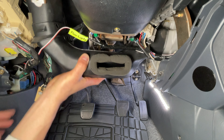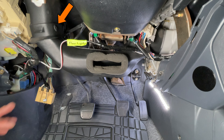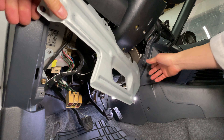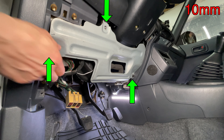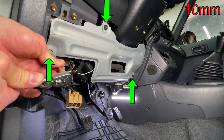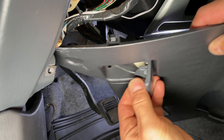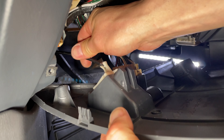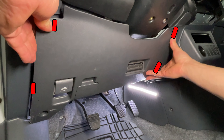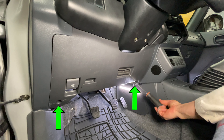Install the right side of the vent duct first, then the left. The push pin starts with the pin sticking out and is locked when you push the pin flat. This metal panel can hang from the little hook above the middle bolt. Install all three bolts with your fingers first, then go back and tighten them with a 10mm socket. Snap the fuse box back into the lower plastic trim, then reinstall the hood release cable back into the handle. The lower plastic is held on by four snaps — the upper right corner slides under the trim by the ignition switch. Install two screws at the bottom of the plastic trim.